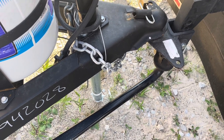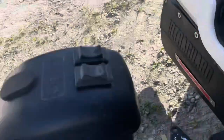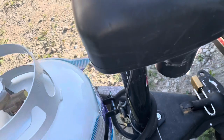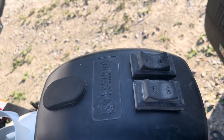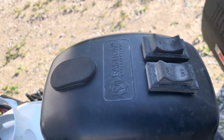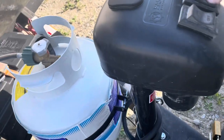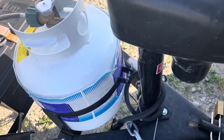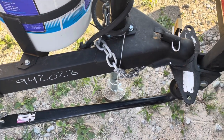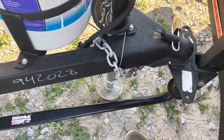The neck keeps the back end of the truck from squatting down. Once that back end squats down, it takes weight off of the front tires. Your front end becomes lighter, your front wheels will start to toe in a little bit, and that will lead to premature tire wear. I'm going to go ahead and raise this jack the rest of the way up and we'll continue after that.